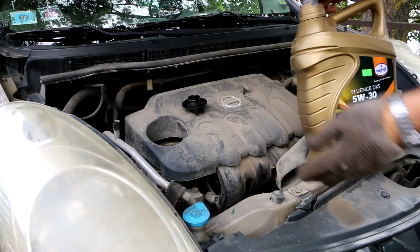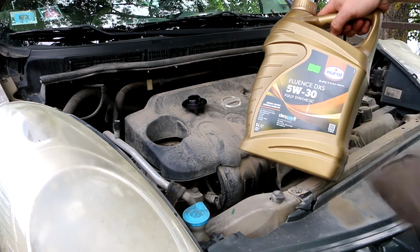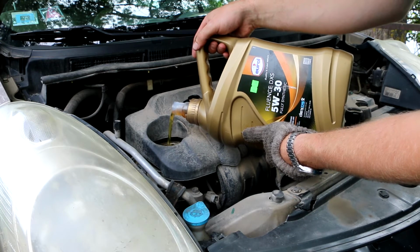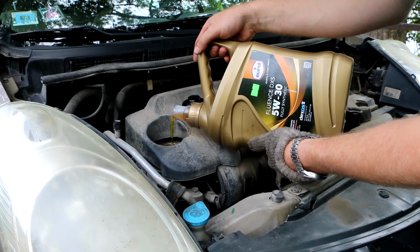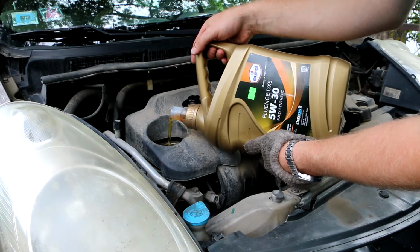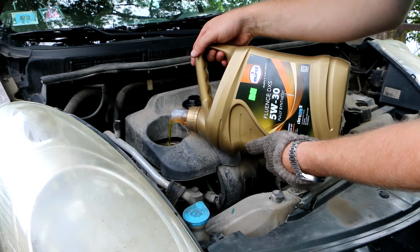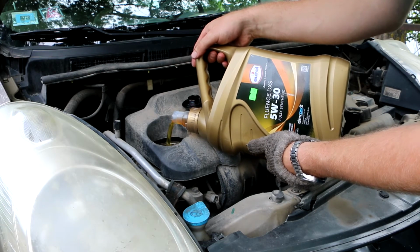And next, just take the oil. Well, what oil will you need? For this case, you can use 5W30. So you will need around 4 liters, 500 grams for this one. The engine total capacity is around 4.6 plus filter, but because there's some oil inside already, because you never will be able to drain it all, you will not need all this volume. In most cases it will be enough with 4 liters, 200 grams or something like that.